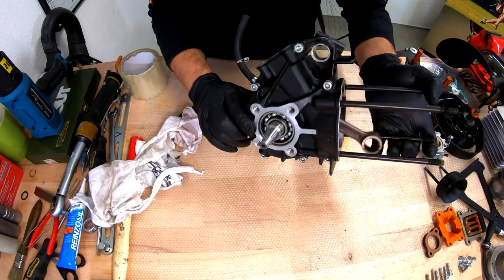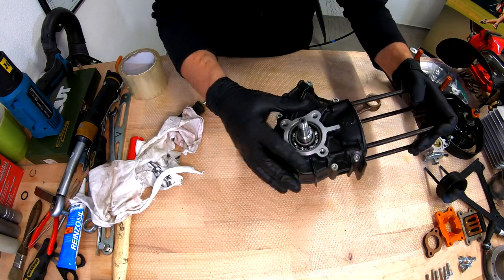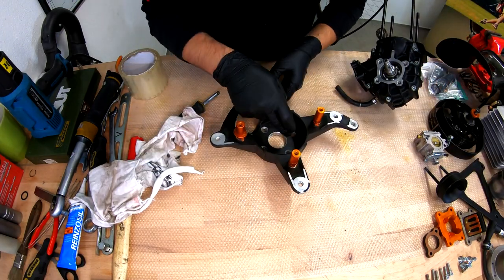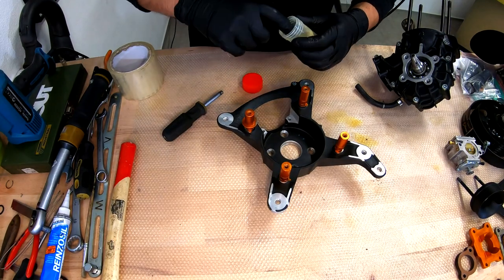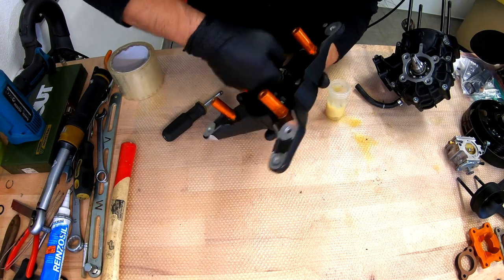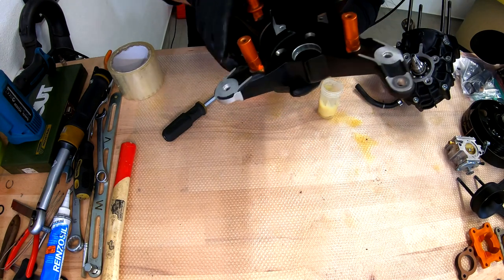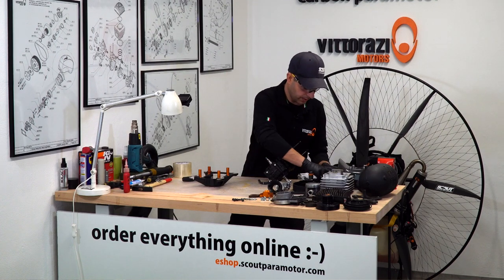Bearings are in. Now we should install the engine carter support, the X bracket. For doing this, we will first install the new seal, crankshaft seal, in. Again, a little bit of grease. We already have a video about replacing the seals, the crankshaft seals, so if you're not sure about it, just click on the link in the description down below and see how we did it.